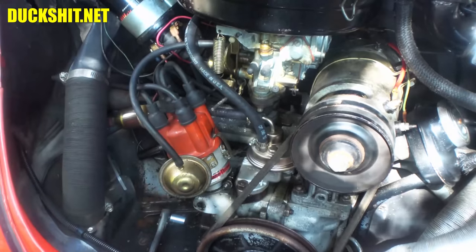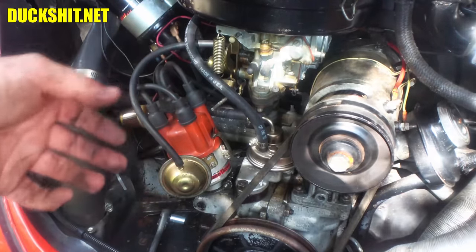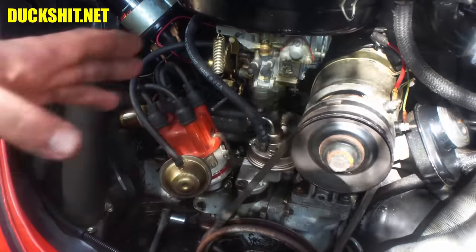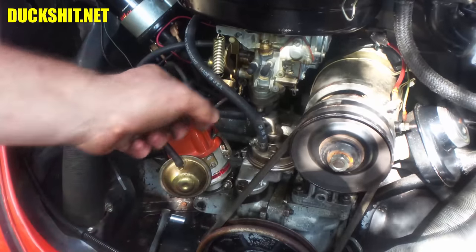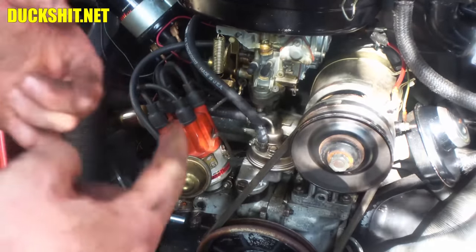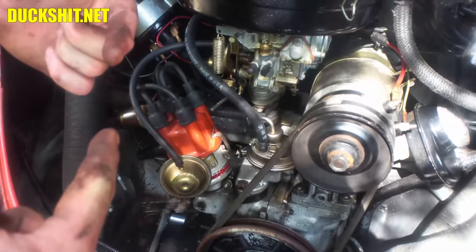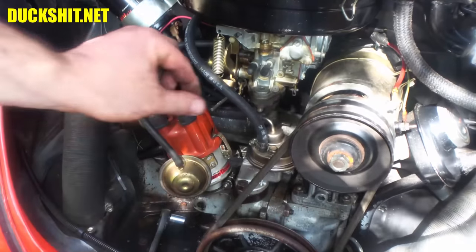Nonetheless, this is solved. This is the easy way to do it, and it doesn't work all the time, but I'd say 80-90% of the time for me. It allowed me to make a home run, essentially, to run that cable right through all those tubes, and everything was in alignment because the other cable held it there. If you push a little too hard or you do something a little jerky, I guess you could push them apart, and then when you try to snake the cable through, they can go like that. I've experienced a lot of different weird things, but you saw it yourself.